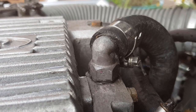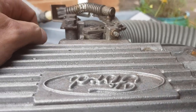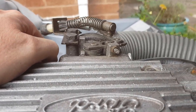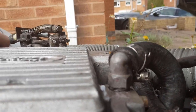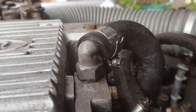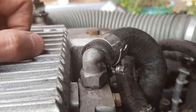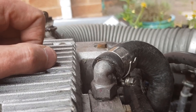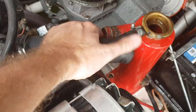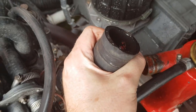I've put the screw thread at the bottom. The reason for that is the only higher thing I can see is the throttle cable. It might be an idea just to keep that down there — it may impact the bonnet if you put the screw thread on the top, it's quite close. So we're going to put the antifreeze in here.